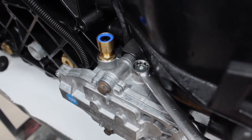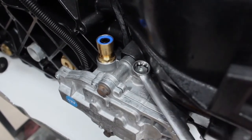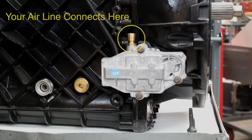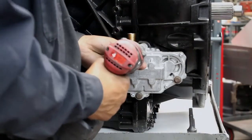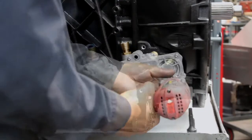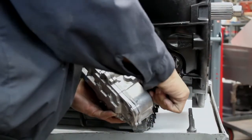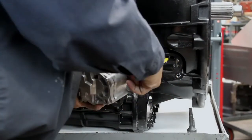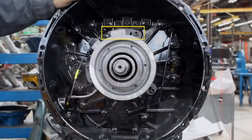On your slave valve, remove the service plug. Make sure to cover up the port to prevent debris from getting inside. Remove the airline and valve mounting fasteners. Then disconnect the clutch position wiring harness connector. If there is a strap securing the wiring harness, cut it and remove the valve assembly.